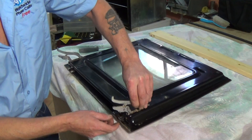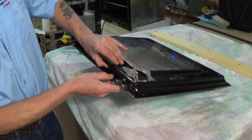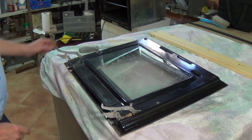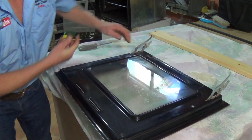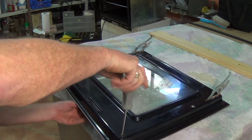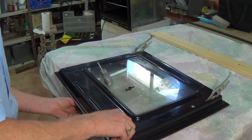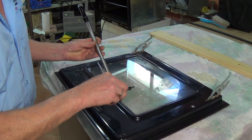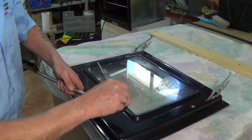Now what we're going to do is strip the door apart. The glass is separated from the bottom brackets but it's still connected at the top with the two handle screws — here and here are the two screws that hold the brackets. So we're going to turn it so the handle is over the edge of the bench and remove the two screws. These two screws actually do hold the glass in place as well. Remember that different manufacturers do assemble doors in different ways, so they're not all the same. This door is held on with two brackets at the bottom and the two screws which I've just taken off, as you can see here.